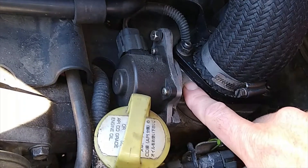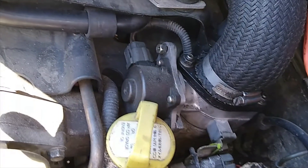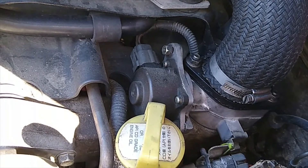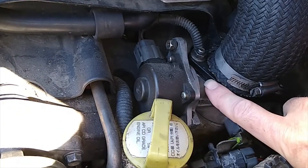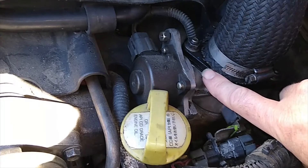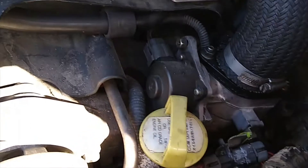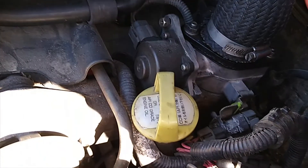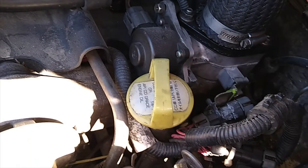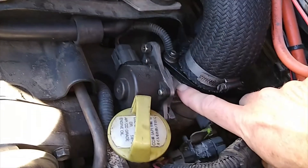Have I noticed a difference? Absolutely nothing — apart from one thing. When you go to turn off the engine, the engine will give a good shake just as it shuts down. The reason is that just before shutdown, the engine closes the butterfly and creates a vacuum in the cylinders, so there's no compression and it shuts down smoothly. Have I noticed any fuel economy differences? No. Any more or less engine power or horsepower? No. So it's debatable whether removing the butterfly has any benefit at all.